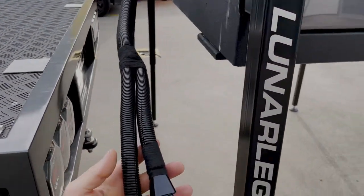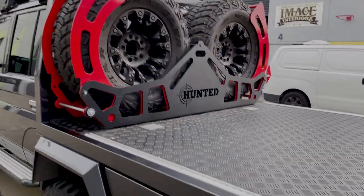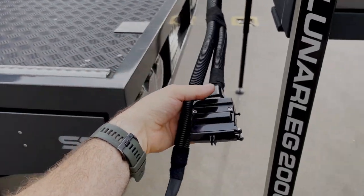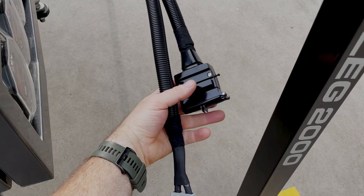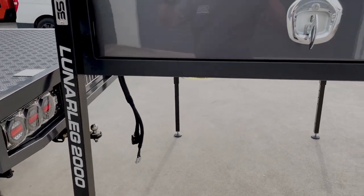Here's the umbilical cord — it's longer than normal because we've got the tyre carrier there, so it goes over the top of the tyre carrier into the top of the headboard. In this plug we've got our rear view camera, central locking, internal lighting power, and this big fat one is used for charging the battery via the charger.